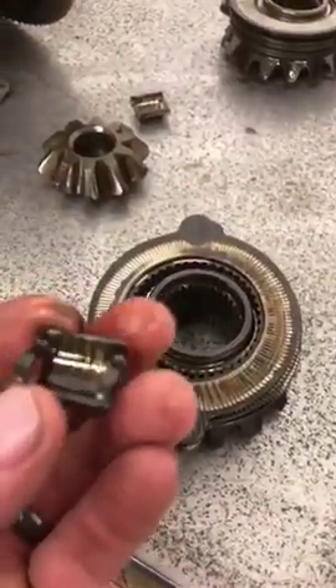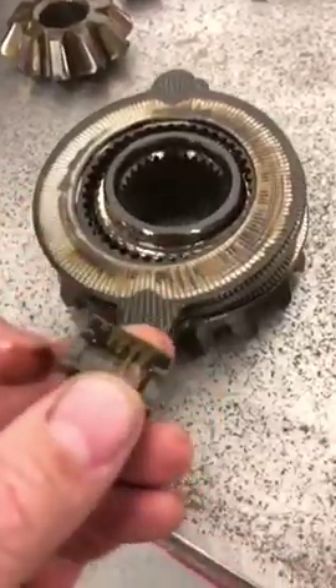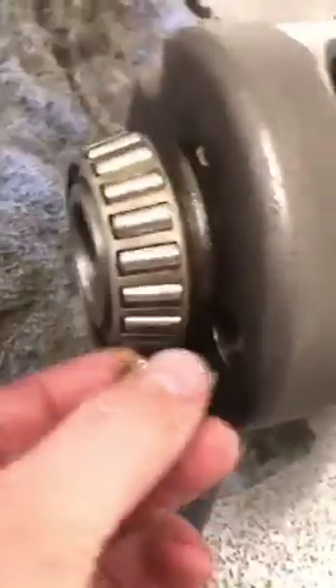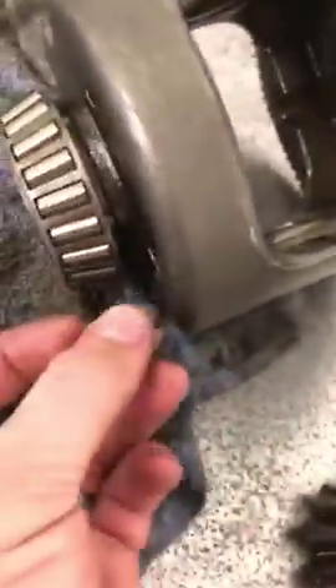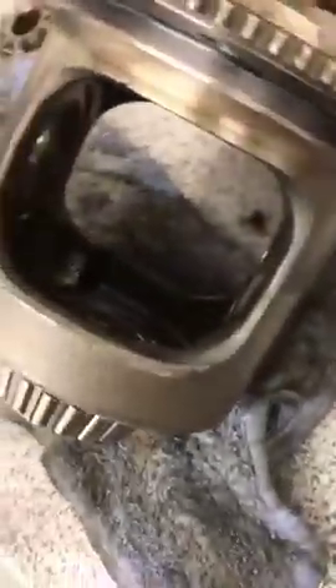The other clips that were broken apparently grew legs and walked off. But what happens is this little piece right here breaks off - this holds the clutches and sits right in this hole right here, one half. That breaks off and then the clip walks out. And once those walk out, your clutches start cutting grooves into your carrier. This one's not that bad, it's usable, but sometimes they get really bad.